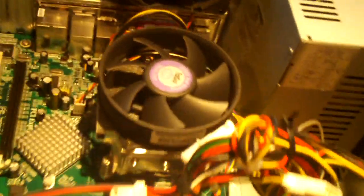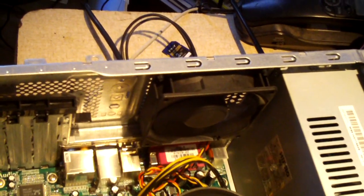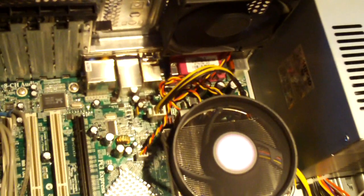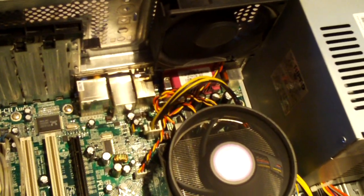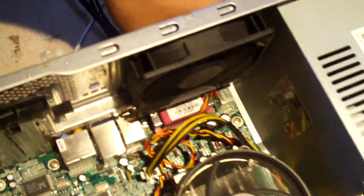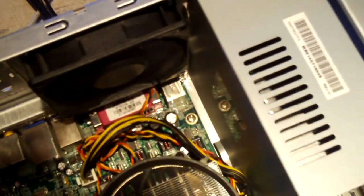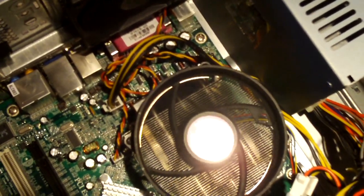So let's plug it back in and try to start it again - you'll see the same thing happen. As soon as I plug power to it, now it's going to start up. But it's not posting. Now all the fans are running wide open. Unplug it. Very weird - sounds like it might be a motherboard issue of some sort.